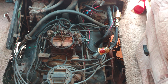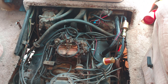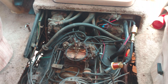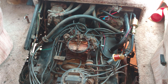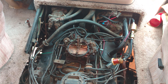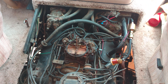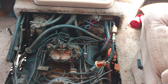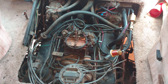What I was going to do anyway was replace the mechanical fuel pump. I wanted to remove it and replace it with another electric pump that could be somewhere with easy access. The main thinking was I want to reduce any energy that the engine has to use — the engine has to use some horsepower to move that mechanical fuel pump. If you remove that and put a block plate on there and go electric, the motor gains probably about 5 horsepower.